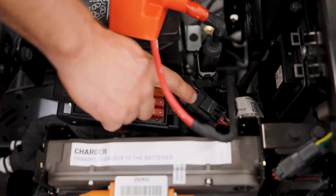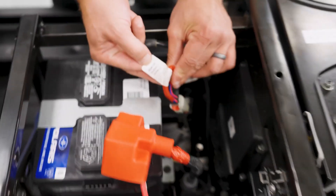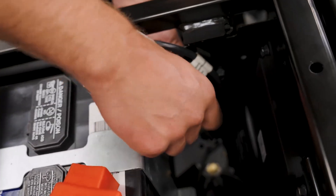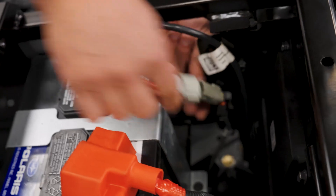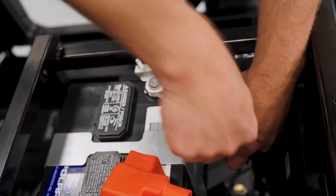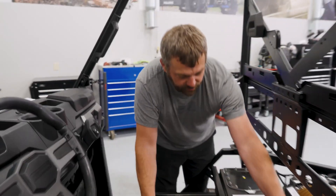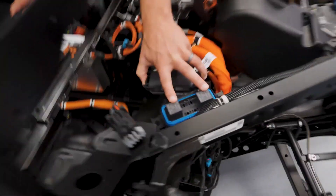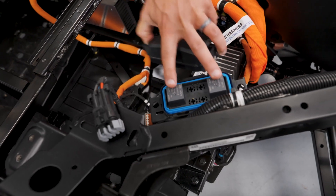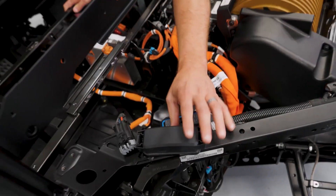You've got a diagnostic connector port here for plugging in digital wrench at a dealer. There's also a service disconnect connector — as you can see it's labeled 'remove during service' — so if you ever have to work on this vehicle, pop that connector off to disable the electronics, making it a much safer environment for any technician. In the back you'll also see a couple of giant relays that control the DC-to-DC converters, turning them on and off as the vehicle is being utilized.